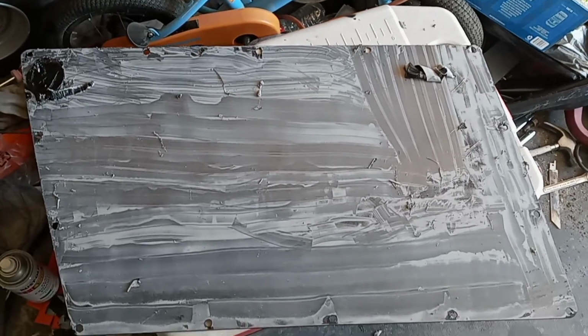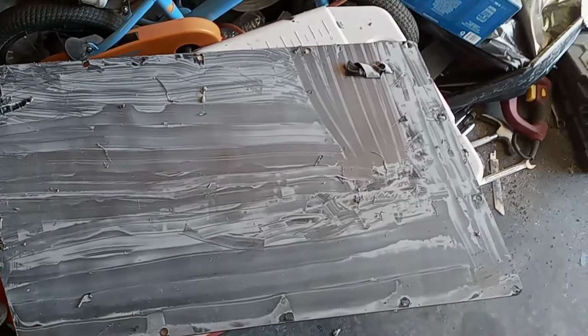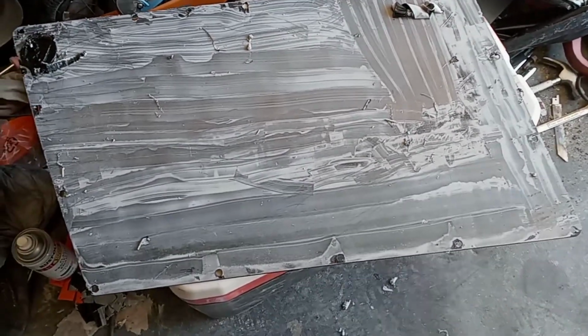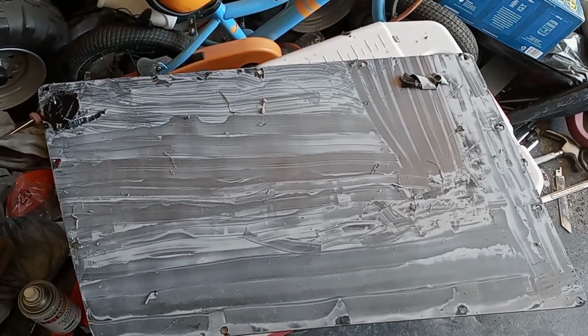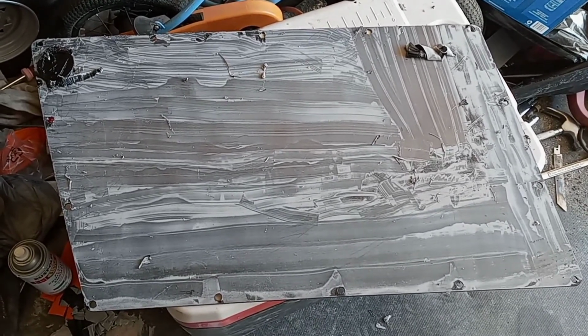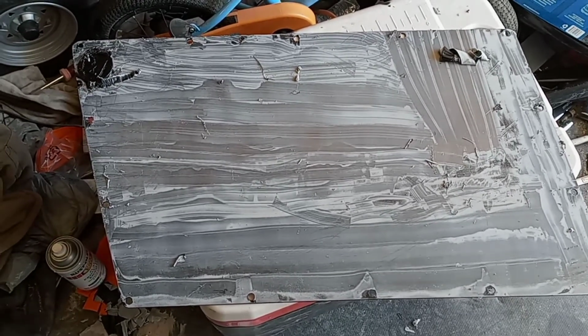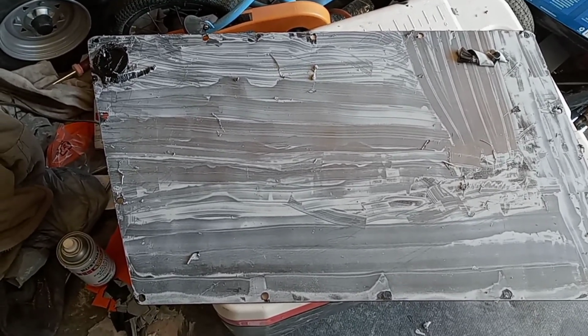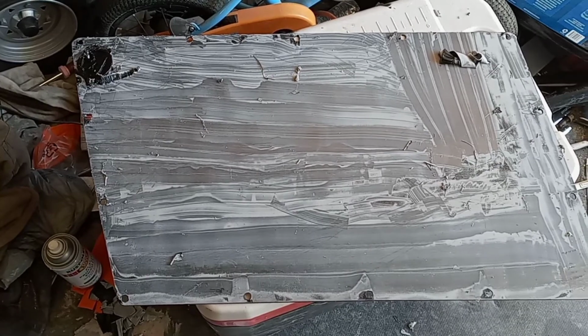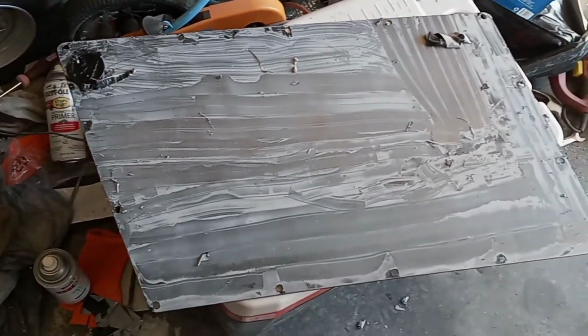Well, you guys, one thing when I started this channel, I said I'll never hide any problems I have. I thought my baking idea would work in a hot room. It was 72 degrees in the house, and I guess not. The paint started cracking, and anybody who knows, that's either too hot or too cold, or even too thick a coat for the weather. So, scraped it all off, and got to start again.